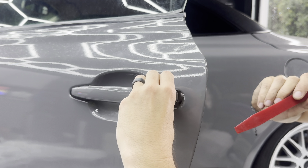Let's get the tail lights and the spoiler removed. Tail lights are extremely easy — there's one bolt here, and then to get to the top part of the tail light it's simply just these two little bolts. Take off the one bolt and pull it out away from the car; it has two little pins that go into those holes, so you pull it out. For the top tail light section, undo the two bolts and then there's a clip where you pull it away from you, then slide it out.